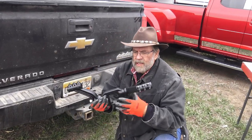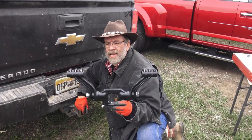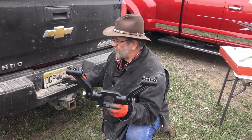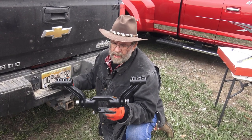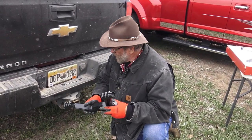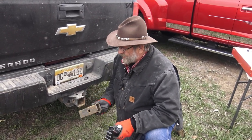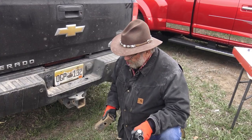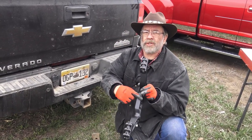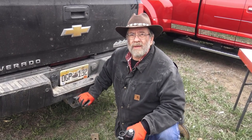This is the main piece — this is called the yoke. This is what determines whatever size hitch you have. This is a two-inch, like what I would use. Now on a dually like this, you need a two-and-a-half, sometimes a three. So we've got all three different sizes of yokes: two, two-and-a-half, and three. He's got a sleeve in here, so we're actually going to sleeve this hitch. All you need is one inch across there between your hitch and your receiver to make these work.